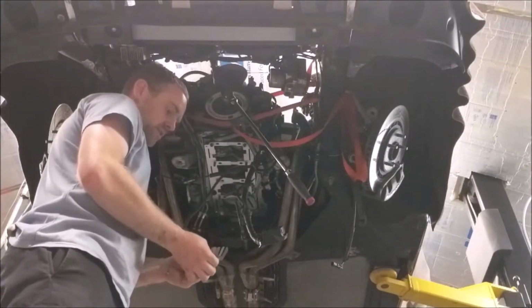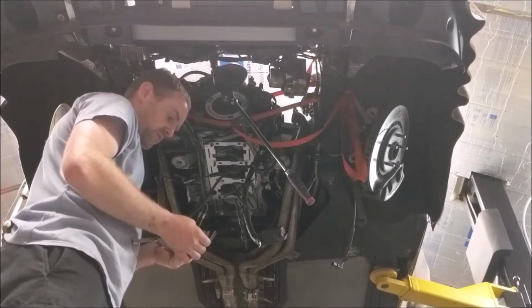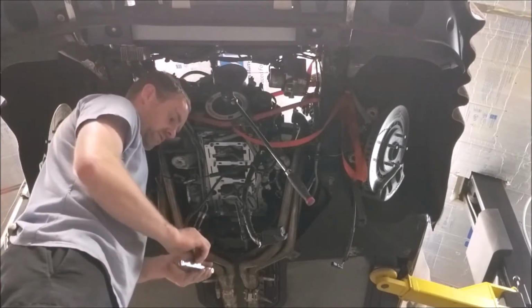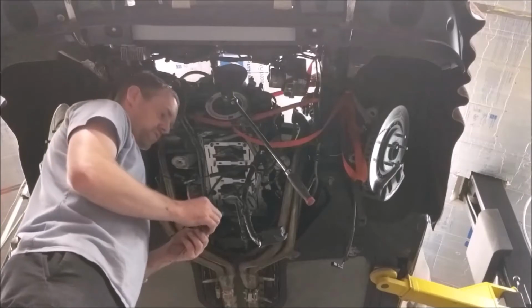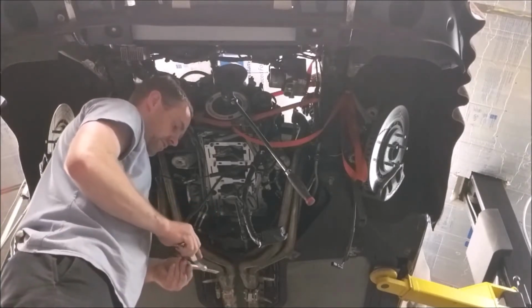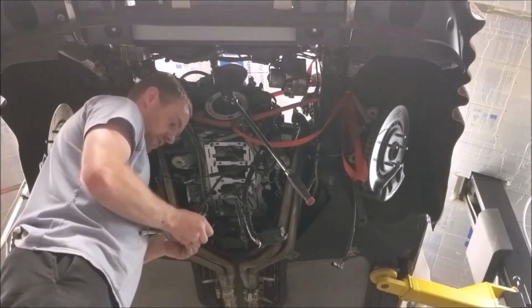On anything that's got a side clearance, I would like to have 20 thousandths of clearance. Anything that has an outside rotating clearance, if it's like a rod specifically, I want 40 thousandths. I'll probably end up doing 40 anyway, but we'll see. Depends on what it comes out of. Maybe I've already got that kind of clearance.